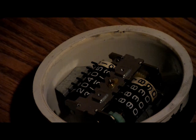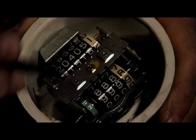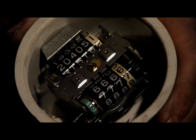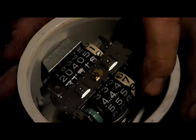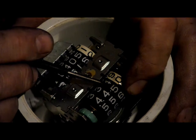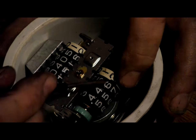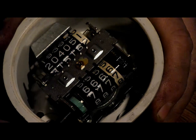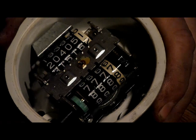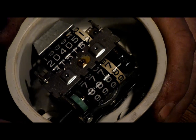The trip meter is not working, but it turns. It hangs up - this is just resetting it now. When this turns, it hangs up and it's this wheel that's causing a problem - it doesn't want to go through most of the time. Because it's close to the six - it's always the six. You can see that one hang up; it slows it down, everyone wants to go except for him. Then he clicks and he kind of goes, and then he hangs up between the six and seven.